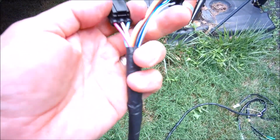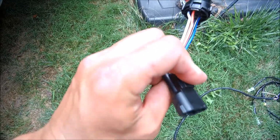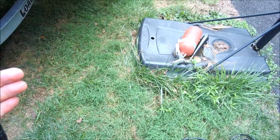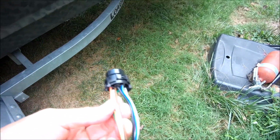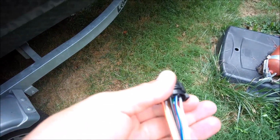And all I'm hooking up here, they split the wiring harness here, as you can see. Over here is all you need for your control box, the basic functions of it. Again, the 3-pin for power tilt and trim, and you got your 8-pin for everything else: ignition, buzzer, warning lights, all that good stuff. Power on, all that stuff.